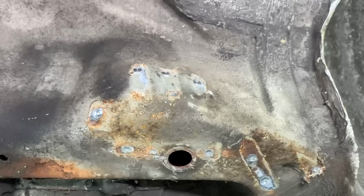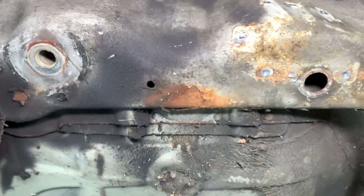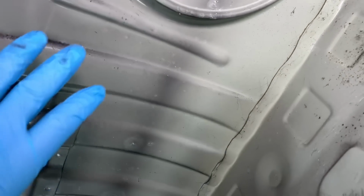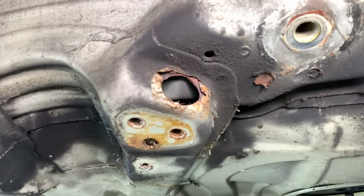That's what was underneath the fuel tank bracket. That's where the fuel tank has been rubbing on the RACP. It's just been creating a bare metal effect. And then you look at other areas of the car and they're absolutely beautiful. Just not even any seam sealer needed. They just stay fantastic. It doesn't take much to actually corrode cars, moisture and salts and water and mud and things like that.